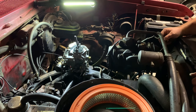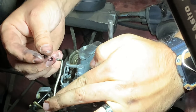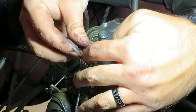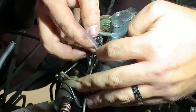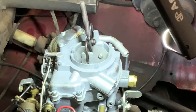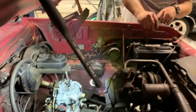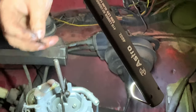Got to get the choke hook, kickdown hook, gas line, all the random vacuums, and the throttle panel reconnected. The choke cable goes through the lever and also through this clip here - get that all lined up, snapped in, then push down and it holds it in. Pretty simple. That's the choke. The kickdown is the same way, just a little bit bigger because it's a larger rod - it clicks on the same way.